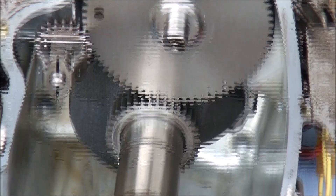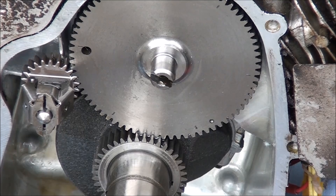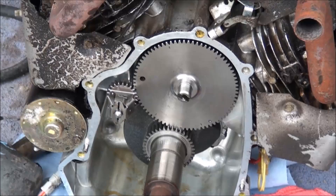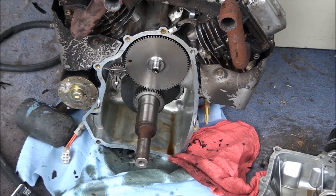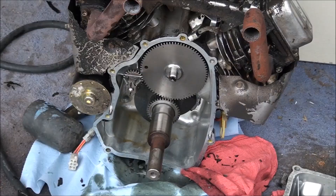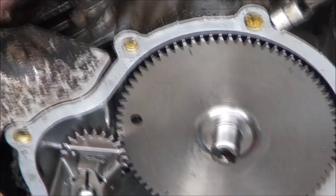If this gear falls off, you'll just want to make sure to line them back up. To do that, you line up the dots — see the dot on the cam and you have a dot there on the smaller gear. If you do it right, those won't even come out. If the cam falls out you're going to be in a world of hurt because you'll have to adjust the valves and put the push rods back in and all that. When we put this thing back together, you can see on the end of the cam there's a slot — and that slot goes down into the oil pump.